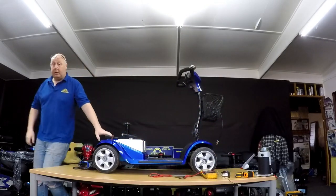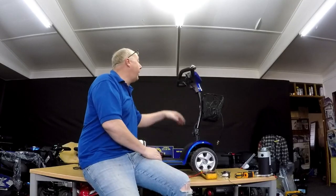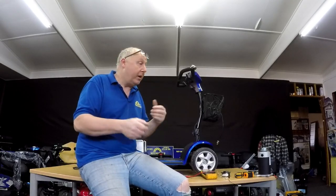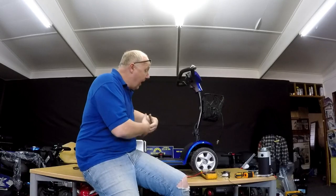What else can go wrong with your scooter in storage? You've got your electric brake, you've got charging issues — another problem is your control box. Why do control boxes suddenly just go? They're working fine, you drive it in, then you come to start it and it gives you an error code — control box error. The reason is if you put it in a damp shed, dampness can get into it. If you take it out on a wet day and put it away without drying out properly, that's different from keeping it in a warm room in the house. The electrical components inside — you've got relays for switches — whenever you press forward, the relay tells the electrics what to do and how fast to drive. These can seize through time. Ask a member of the family to go out, take the key, switch it on, drive it back and forward. You've moved it a little bit, everything gets used, things will dry out.